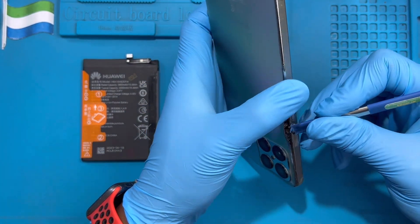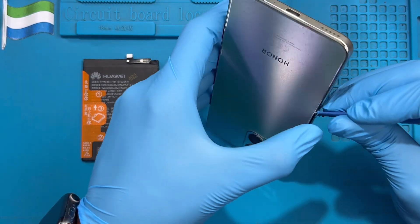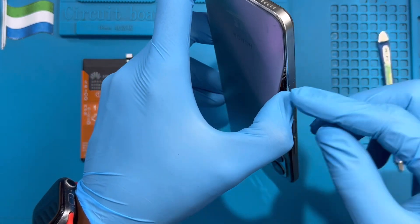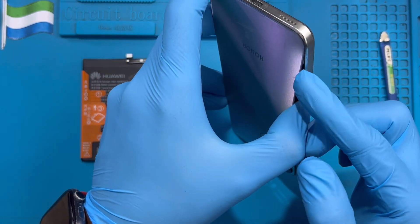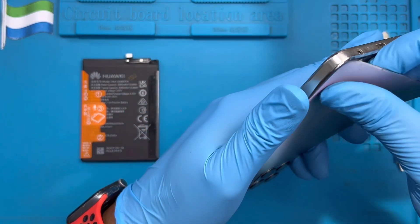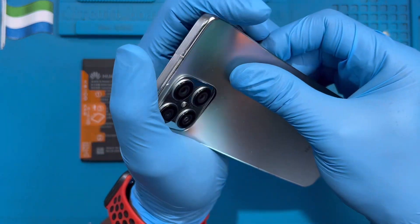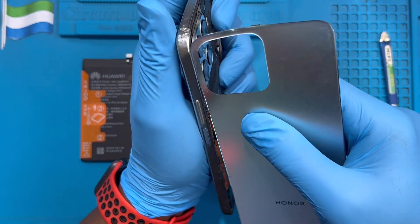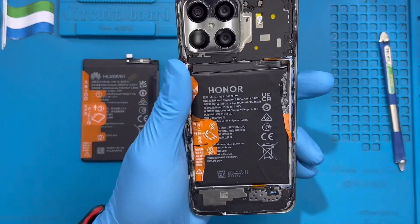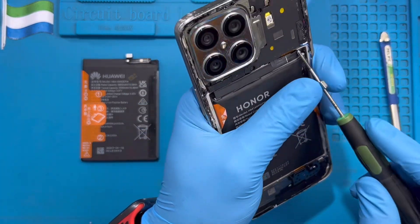Try to open the cover now. If you don't have the heating machine at home, just force it open — don't be scared. This is rubber, not glass, so use your hand. You can even use your fingernail like this because the rubber is not going to break. Just open it, put your hand inside, and open it. Take out the back cover to one side — as you can see the battery has become very big on this side, which is why the battery is not working.